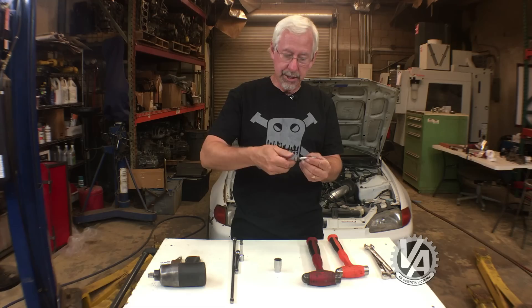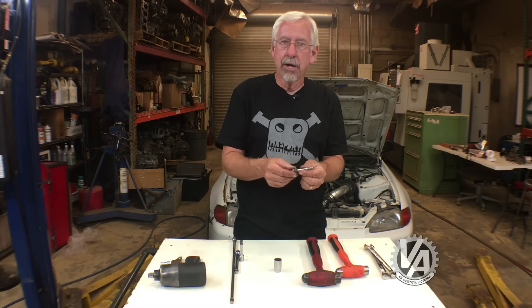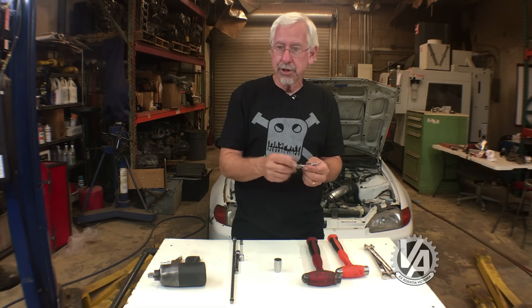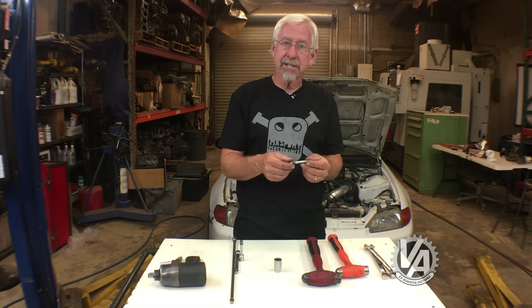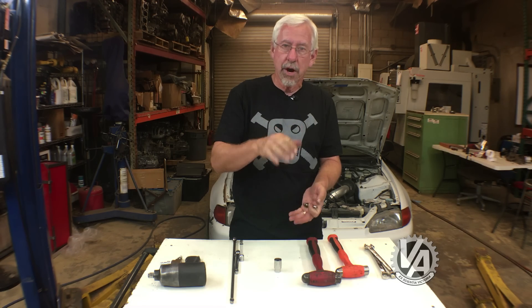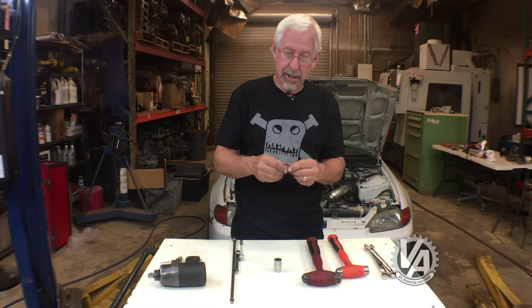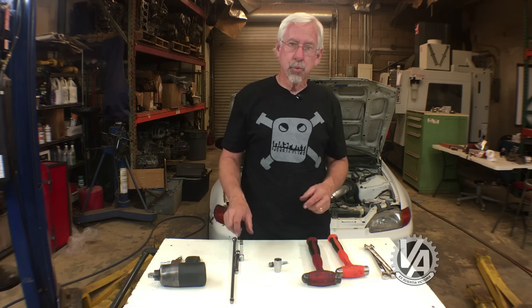Once you do that, you can take the one nut and use it to unscrew the stud. This works particularly well on intake manifolds — I had to use it when I was trying to pull a stud off an RSX manifold so I could tilt the manifold off without pulling off the water pump. Saved me a lot of time resealing the water pump.